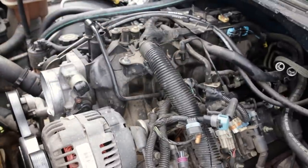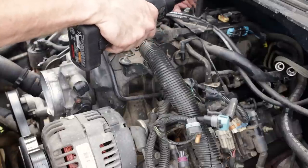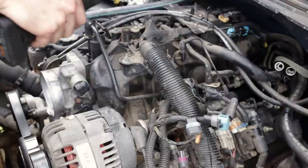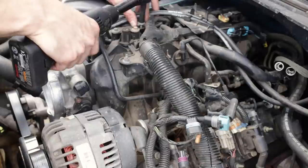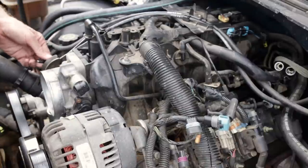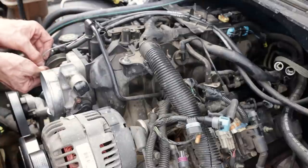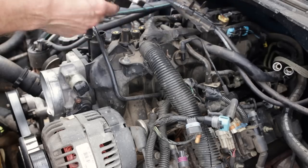We'll go ahead and remove the two 10 millimeter bolts for the throttle cable bracket here. Get that loose. We'll go ahead and remove these 8 millimeters here for this throttle body bracket up here. Throttle cable. We'll disconnect our throttle cables over here. They just pop on and off. For the outer, the inner, you open the throttle, hold it by hand, pull the cable forward and slide the little dowel pin out. Now we can set our cables off to the side.